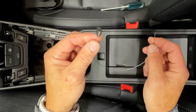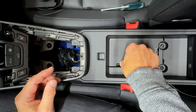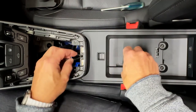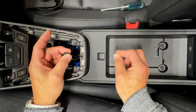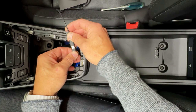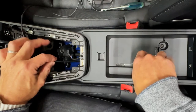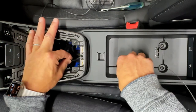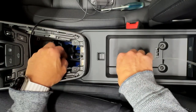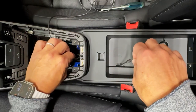Your unit came with this fishing tool. Take the plastic end of the fishing tool and run it into that little area we just cleared out and watch for it to come out the other side. Once it's out the other side, keep this end so you can still grab it. Then take your USB and plug it in, and we're just going to pull that back through. While you're pulling you should be pushing the wire from the other end, otherwise it'll probably pop off if you pull too hard. It might take you a couple tries, especially if the tool gets turned.